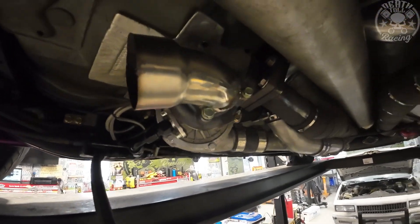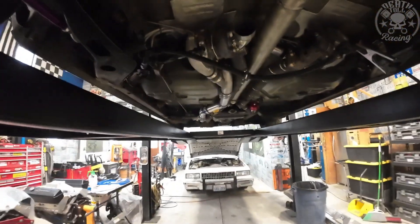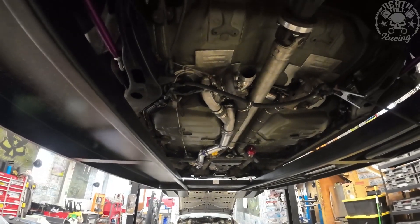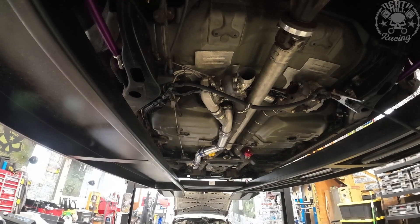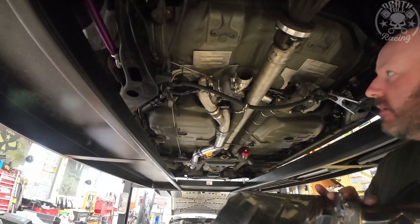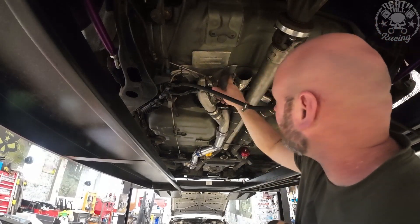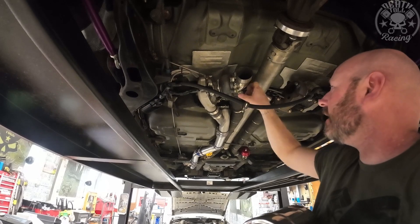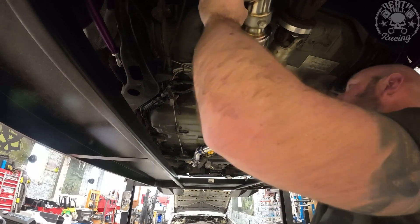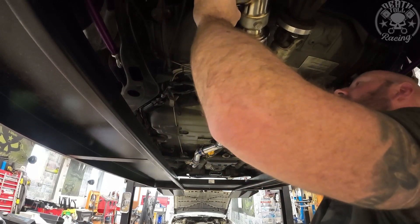I'm not going to lie - that is one of the ugliest parts I've welded in a while, but it'll work. The welds are just oversized because they look like crap. I don't have tri-mix, so I tried using straight argon - that doesn't work. It was better with argon CO2. Luckily that hole is slotted, so you can slip it on there. Hopefully once I get this part welded on, it's not harder to get on.